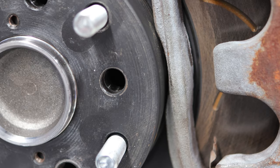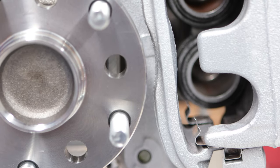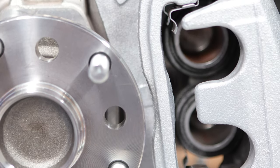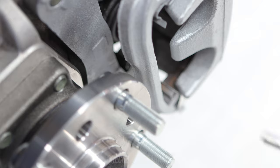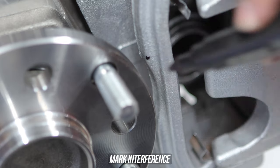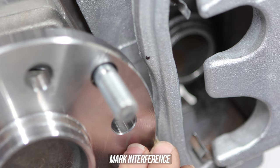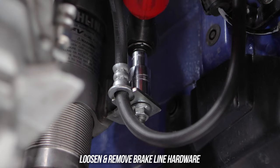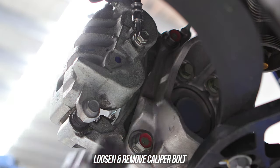For non-Brembo setups, with the hub on the car the caliper sits super close to the rotor hat. In its current diskless state you'll see some clearance from the hub to the edge of the caliper. This can be measured with your favorite measuring device, or you can use a 7mm drill bit — roughly 17/64ths or 9/32nds if you're from the USA — and run it alongside the hub to check clearance, which is probably the most accurate way. If there's interference, mark where the drill bit interferes at the top and bottom as a reference. Then go inside the wheel well and loosen and remove the bolt holding the brake line to the coilover. Head to the back side of the caliper, loosen the bottom bolt but do not remove it, then remove the top bolt so you can pivot the caliper down.